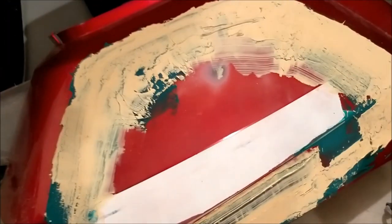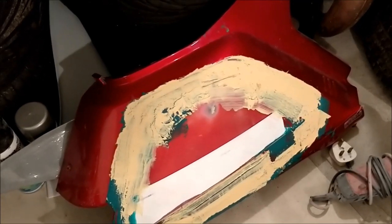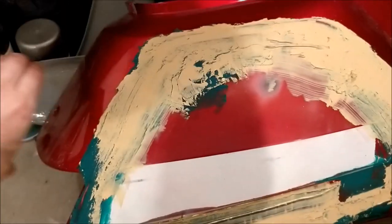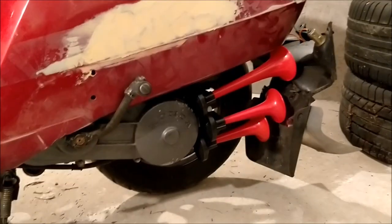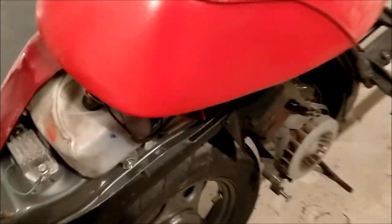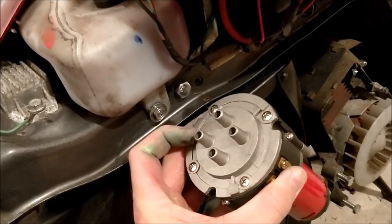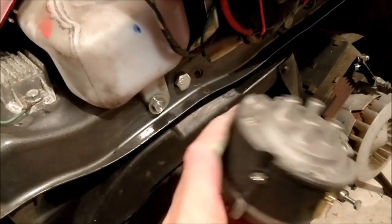This area was where the cubby hole was, but I've completely smoothed out where the opening was and cut out the complete inside. I've used a fiberglass bridging filler to fill the gap — basically like filler but with fiberglass strands — and I've just gone over the top with some spotting filler to fill in some of the holes. I'll sand it all down and go with a bit more filler so it should just be one piece.